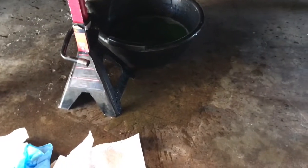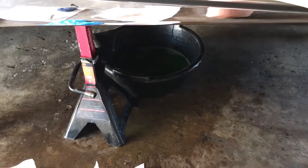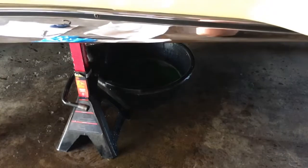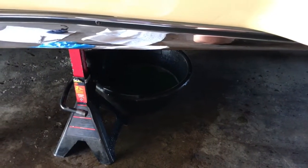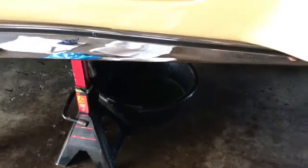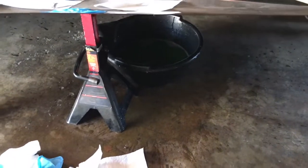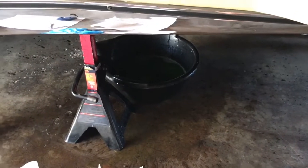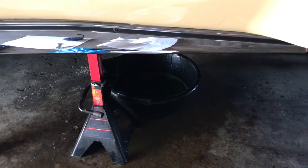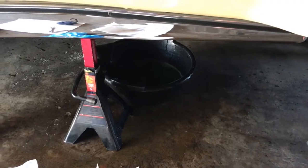That's the kind of mess that happens when you don't have good tools for catching the fluids that come out of hoses when you disconnect them. It's a big mess. Since I took the last video showing you where the heater hoses connect, it's been about 30 minutes — because both of those hoses had been on the heater core nipples for about five years and they were seized. I had to wrestle them quite a bit. It's no fun; you're going to end up with a couple of bruises around your wrist reaching up there. But it's done, and next we're going to move inside the car.